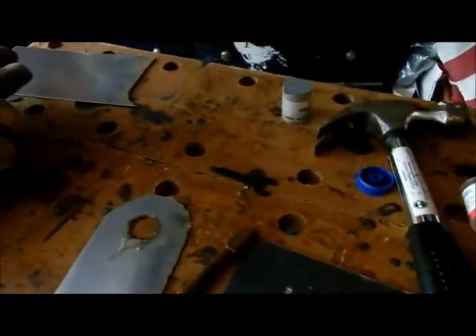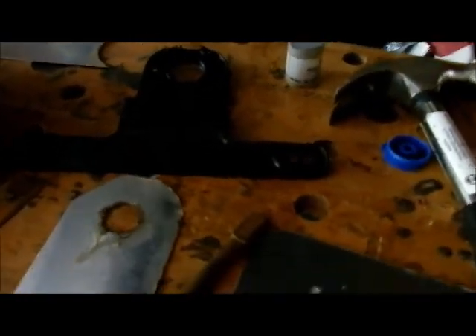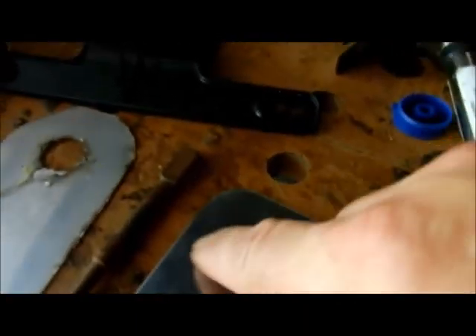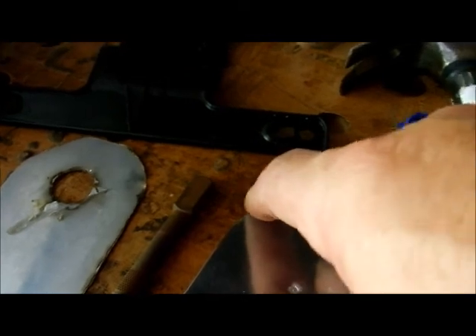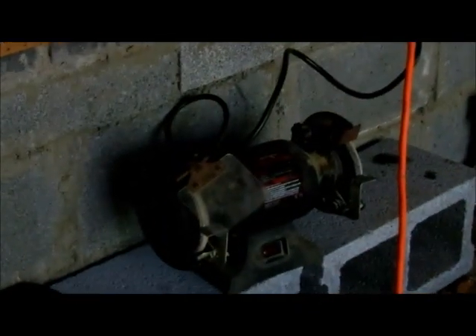In the past 20-30 minutes I have done quite a bit of work — this piece is just about done according to the template. I have to do a bend right there to bring it out underneath the back tail light, and probably two holes, but I am not going to drill those until I get the old one deinstalled. I cut a nice smooth curve, and because this is going to be exposed to anybody's legs going by, I took a grinder over it and smoothed it out, buffed it up, just to dull it a little bit.